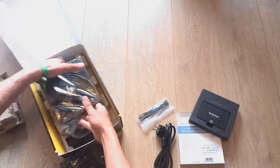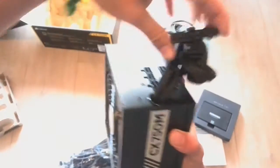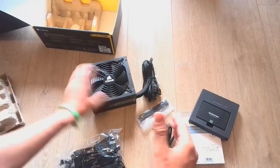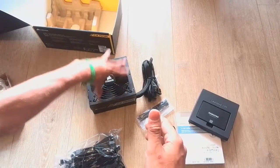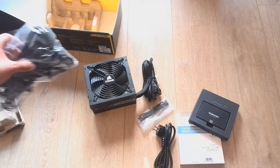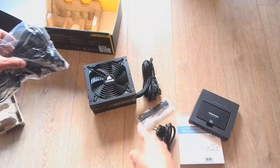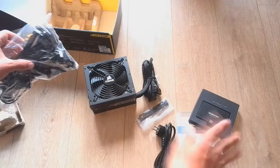power supply itself. The power supply itself has two cables for the motherboard and processor, which are these two cables on this side. One is for the motherboard, the 24-pin connector, and the other one is for the CPU. Because of these cables, that makes it a semi-modular power supply. I know this is really overkill, but I need it to be quiet and the fans to spin less and so make less noise. So if I'm using everything on this power supply, it's still quiet.